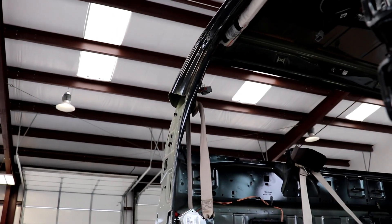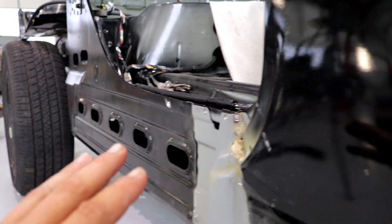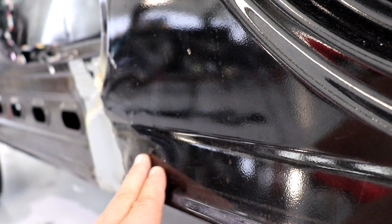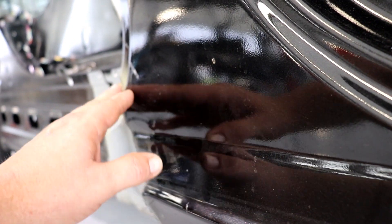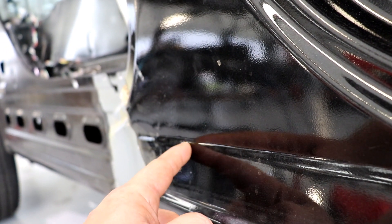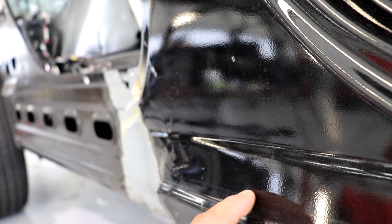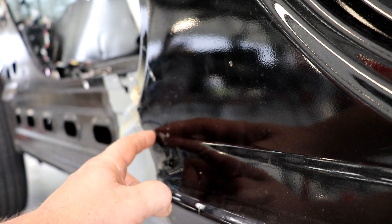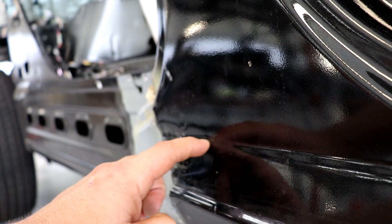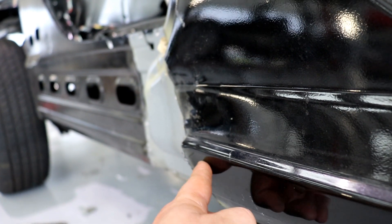We're back in the body shop today and we're gonna get this beast welded up and sent to paint. It's kind of hard to make out what's truck and what's not. I've taken our outside panel off again because where it joins up here there's a little bit of continuation of damage. What I'm gonna do is come in here and pull some of this out. Shooting at this angle so you can see the reflection — you'll see it rounding right there. That should be nice and smooth, so we need to push this out a little bit. Also up here there's a little bit of a bow, so this line right here is what we're gonna work on.